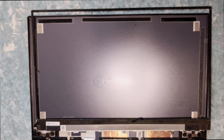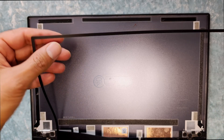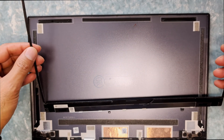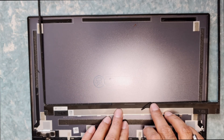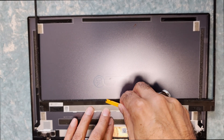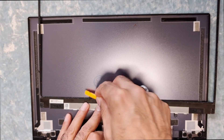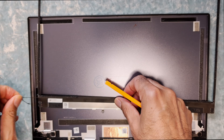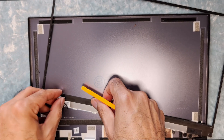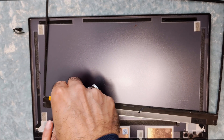Before we install the new screen, we have to do some prep work on the top plate which goes on top of the screen. It's very fragile, especially these top ones are very narrow or small. I can feel the double tape on these corners still has some glue and they are sticking. However, the bottom one doesn't have much, so I'm going to remove this and install new double tape on it. And then we can install. Let's start by removing the old double tape from here. Hopefully it will peel off easily. I'm just going to pause the video here to remove this bottom double tape and then resume after I've installed it.